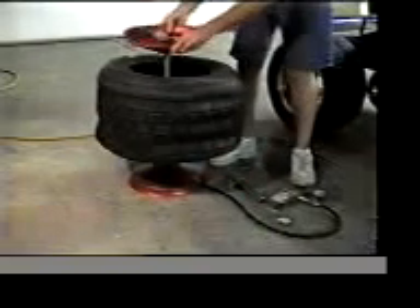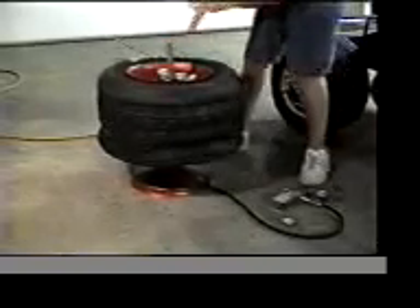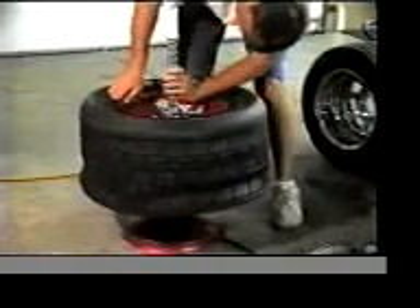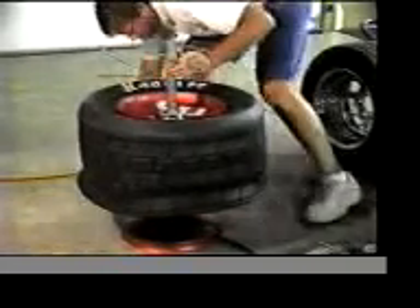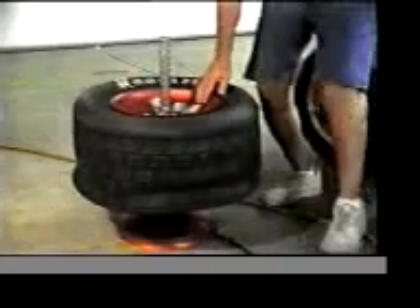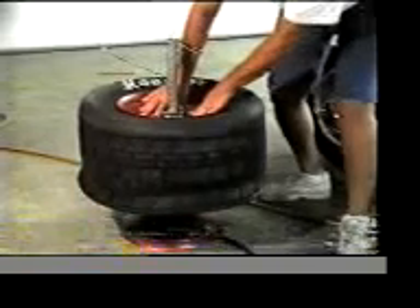Put the top dish on the shaft. We're going to put this at the 10-inch tire mark because that's what we're going to inflate it at. We're going to go ahead and hook up the air. Now I'm going to push on the air and inflate it — you have to hold lightly down on the dish. It's already starting to hold air.